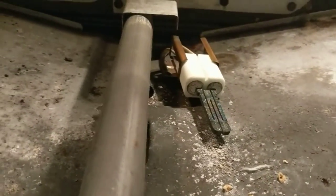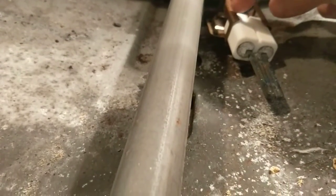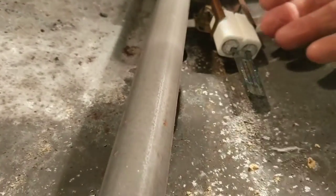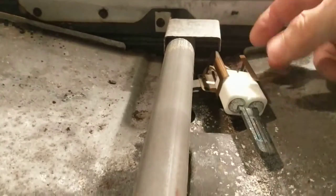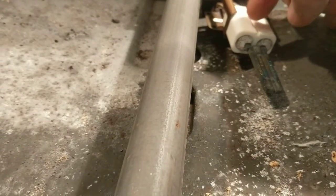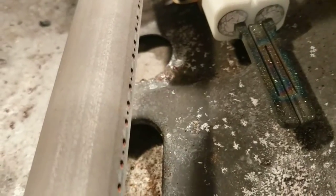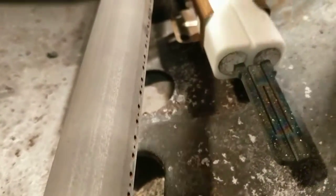The bracket itself is also a little flexible — you can bend it — and there are tolerances in this setup. The idea is to readjust it so the igniter is closer to the gas. The bracket's teeth had widened, allowing the igniter to sag down. So I've tightened up the bracket so it grips tighter, and I'm pulling the igniter a little further out so it extends more into the gas stream and isn't as far back.